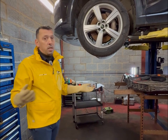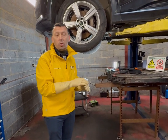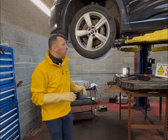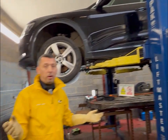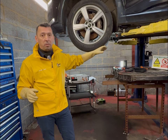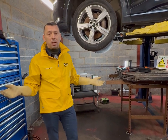From here it's still going to be several hours because it's a slow charge process until we raise it to 395 volts. Then we'll see whether we manage to clear the faults — we have the battery charging but we don't know whether the control unit will recognize the charge or whether the fault will stay and need more work to clear. We're not yet sure whether this was a good buy. Replacing the battery from the main dealer is 32,000 pounds — a crazy amount of money. Keep close to see exactly how this car gets fixed, if it gets fixed.